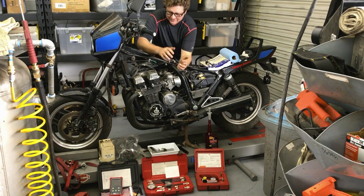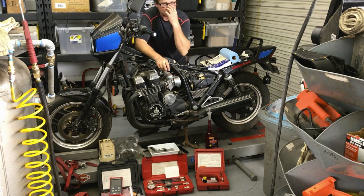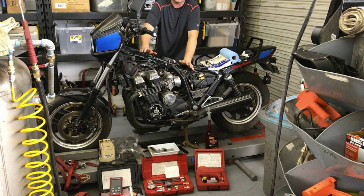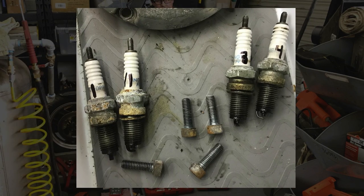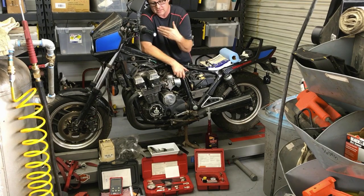We just don't want to cause extra damage. More likely than not, if it's been sitting that long, it's going to have to come apart and be freshened up — but who knows? So the thing we do at HowToWrench that I can't recommend enough is to pull the spark plugs. We've got them in the box here. As we're pulling stuff out, we take the time to number them so we can see which cylinder. That might show you some evidence of how it was running if you see a spark plug that's different on a multi-cylinder.